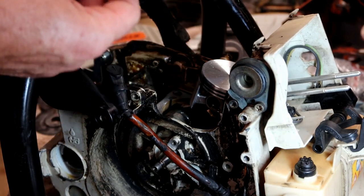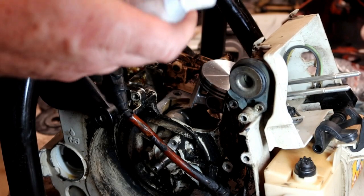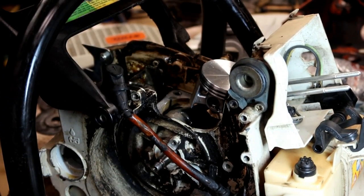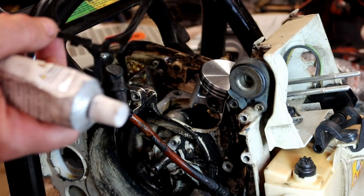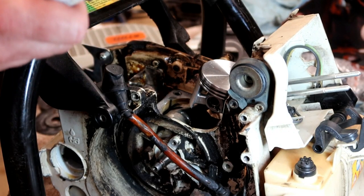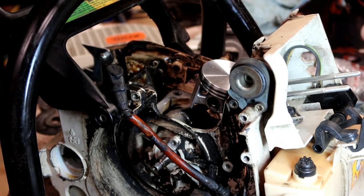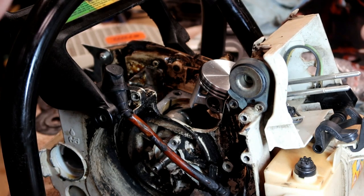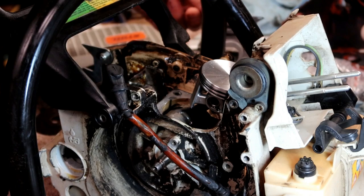So, a product called 3-Bond, greatest stuff since sliced bread. It is fuel resistant, works as an excellent gasket. You can actually omit the base gasket if you wanted to. We're going to put this on. This is a work saw, so we really don't want that high of compression if we can avoid it. But one tube will last you a really long time. I'll link it in the description, but it's worth its weight in gold.